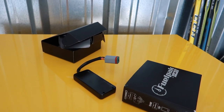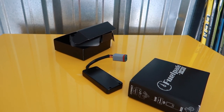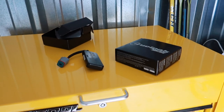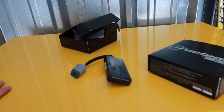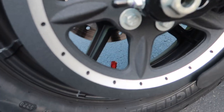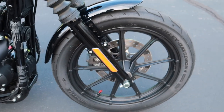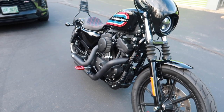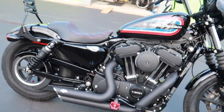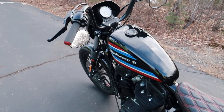There's an app on your phone that you download — it finds the tuner via Bluetooth. You tell the app what you have; in my case, a high-flow air intake and a Vance and Hines Short Shots Staggered exhaust. Because it's a Vance and Hines system, it found those specs immediately, and about 10 minutes later it was good to go. Last but not least, a few little things I thought would look cool — like red tire valve stems. I think that's really about it. I made this bike mine; it's everything I wanted, and I did all the work myself.